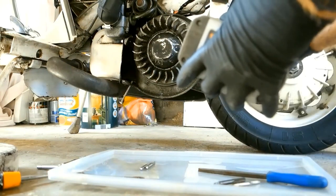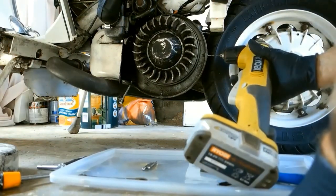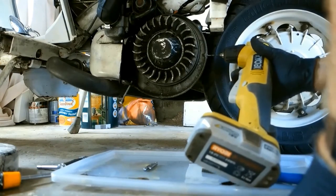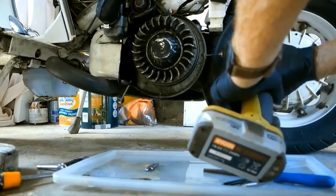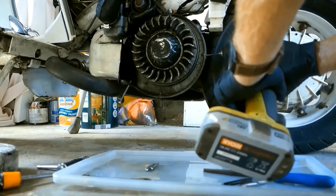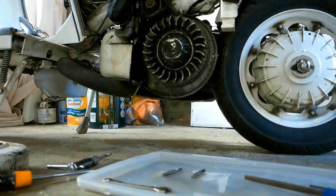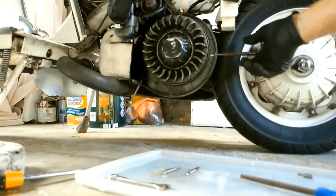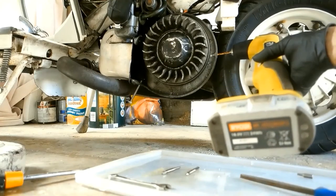I'm not going to take all this apart to get them in the hole, so I'm going with this. I have a toolkit from the building side — 5mm hole, 4.2 drill for tapping a 5mm hole. This is a 2.5 drill. It's a lot of screw. Great damage on the threads. It broke through. I think I'm going to try and drift it out — knock the centre punch in after I chop the screw off. Not sure it's doing any good for the threads.